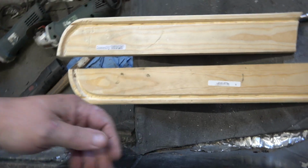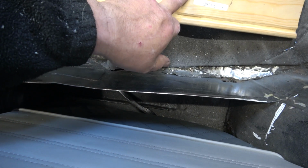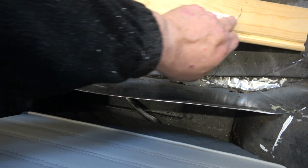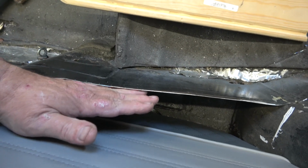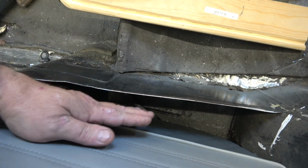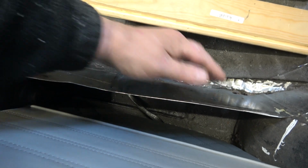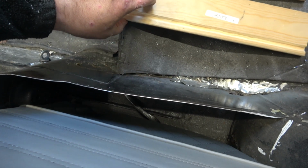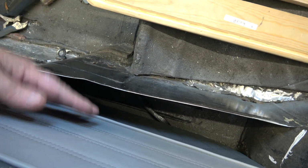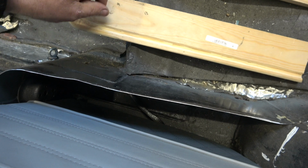So what I'm going to do now, rather than penetrate the door card here, we're going to buy some aluminium angle iron, and we'll put it on the inside of here, which will go on the other side of this metal. So this groove is in here, put this on the other side of it, screw it at the angle, and then we'll put 3 self-tappers the other side where the carpet comes up, and this is independent then. So it can be put on afterwards, or even put on before, and you can push the card down the side. But I can put it on afterwards and just use this.